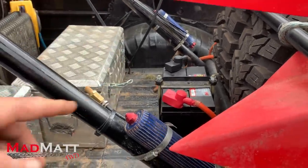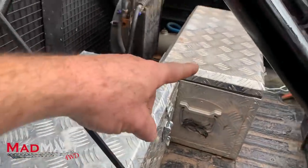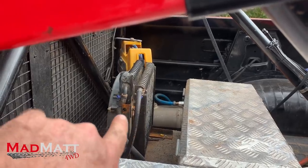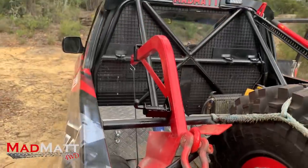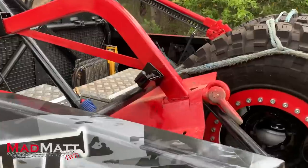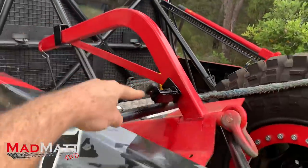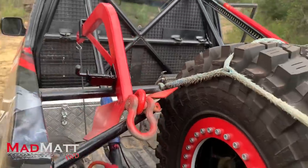This is the diff breather for the rear diff. Here are my remote reservoir canisters for the rear shocks. This box is for food and supplies on race day, and that one is for vehicle spares. These two coolers are for the automatic transmission — I've doubled up two factory Toyota coolers in series and just got a fan that comes on as soon as you turn the ignition on. It keeps the auto nice and cool. This device here is a ground anchor — at Cliffhanger there's often nowhere to hook your winch to, so you've got to dig into the ground. We hook the winch rope to here, dig it in, and when you winch it just ploughs itself down into the ground. Once winched up, we then hook on and pull this out of the ground.